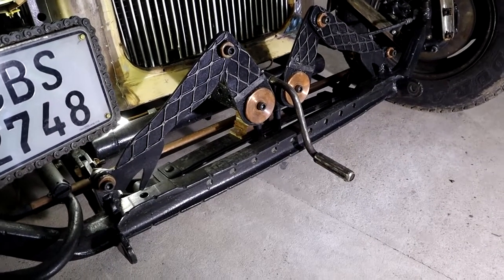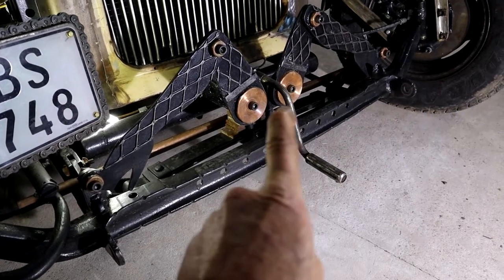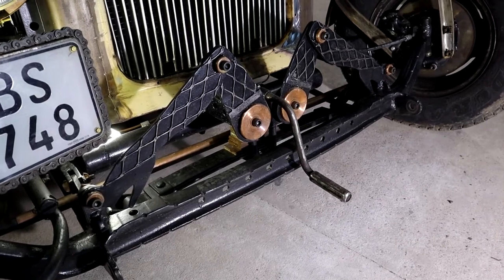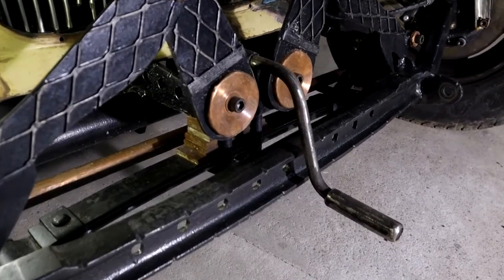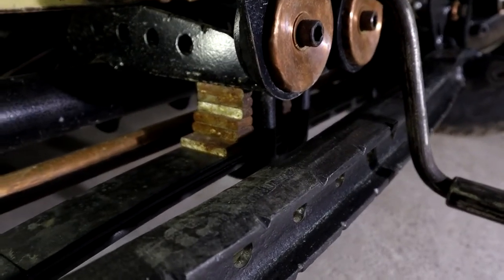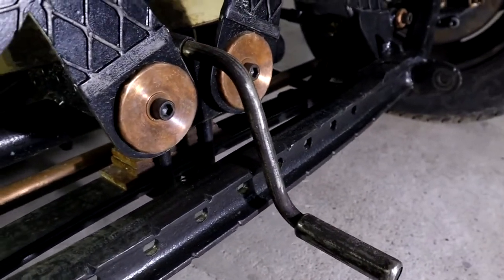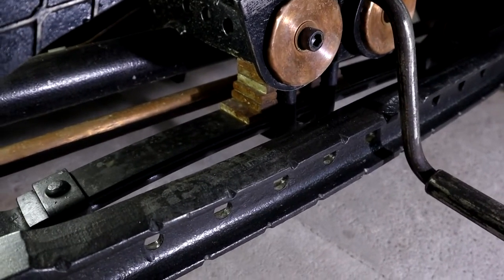Let's start at the front and look at my very first concern, which is the transverse spring. It is way too stiff and the front ride is very very hard. I kind of knew this right from the start. If you look carefully — I'm going to zoom in — you will actually see there are some spacers that sit between the spring and the actual mount to the chassis to take up some slack, because the spring has so little arch. With so little arch it's got very little travel, and I think it's way too thick so it's too stiff.